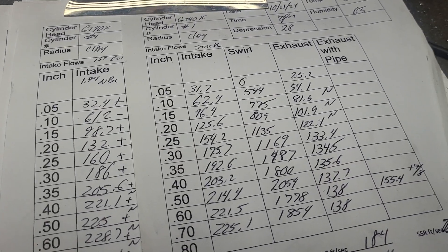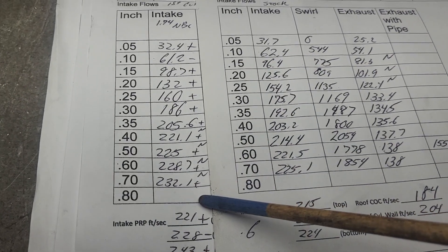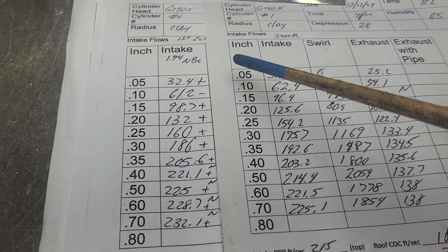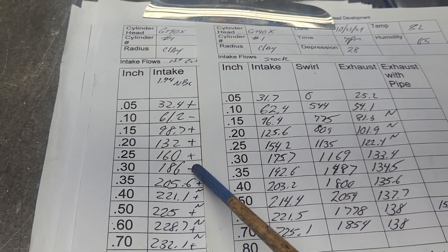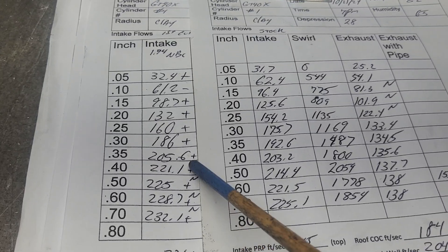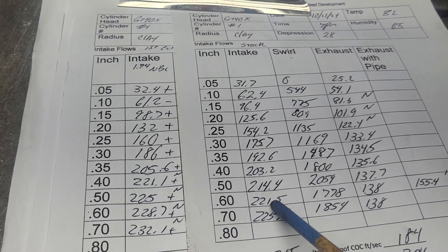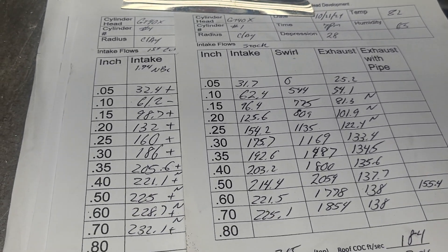Let's see if we can get this done the right way this time. Stock and first cut — you've actually seen these before but not with the pluses and minuses in. It doesn't look that terrible when you see all the pluses. Usually I lose quite a bit right around these low-lift areas when you take those big sharp edges out of the chamber, but this time we only got one minus and it was very small. It went up almost 10 CFM plus at 300, which isn't bad. But we don't top out very well — we're losing it on that short side at 400. That noise coming across the short side is not good; we're going to need to work on this. Our peak numbers: 214, 221, 225, 228 — a little better, but not really as much of a pickup as I would have expected.